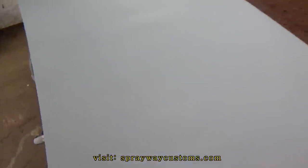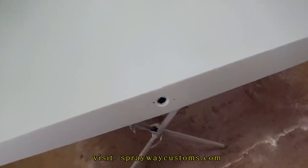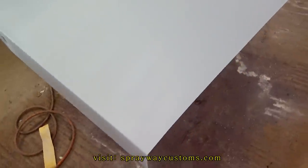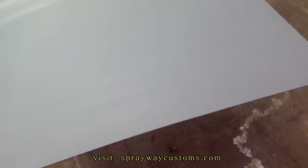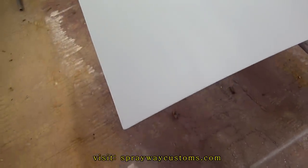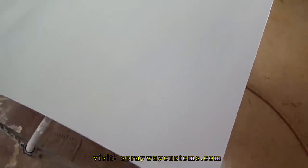Let's get to the primer. You could probably tell my spray gun was spitting. I knew it before I started spraying — I just didn't feel like taking the primer out of the cup and re-cleaning everything. So I just went on with it since it was just primer, because I'm going to have to sand it anyway. It wasn't spitting too bad, but the pattern wasn't even. All I got to do now is put a guide coat on here, then wet sand it, then shoot the candy.